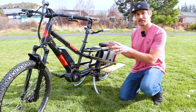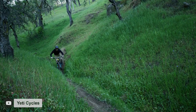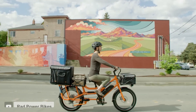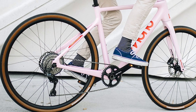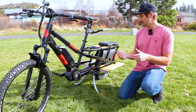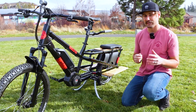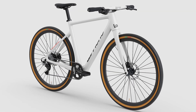You should choose a bike with a mid-drive motor if you're looking for the most refined power delivery system and want a more nimble, agile bike — maybe for mountain biking or e-road biking — because that motor is right in the middle, as opposed to on the rear wheel like a hub-drive motor. Unlike mid-drive motors that put power through the drivetrain, hub-drive motors apply their torque directly to the back wheel. These tend to be more affordable and lighter weight due to their inherent simplicity, but a bit less efficient and powerful. Hub-drive motors also allow the frame to be simpler without having to mount a motor in the middle. Riders on a budget, or those who want a clean, sleek frame that's harder to identify as an e-bike, will find hub-drive motors a good option.